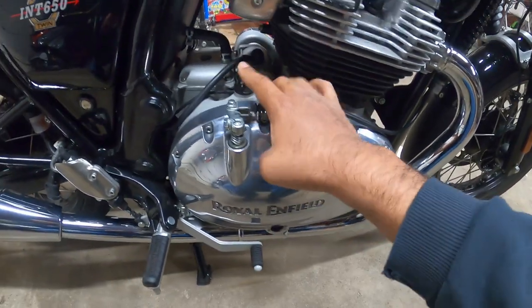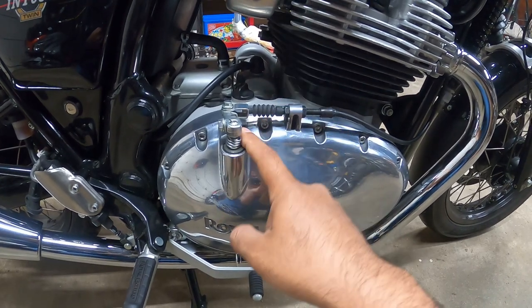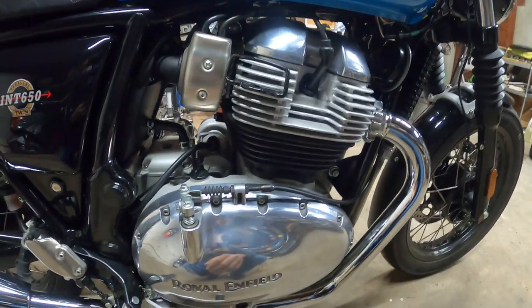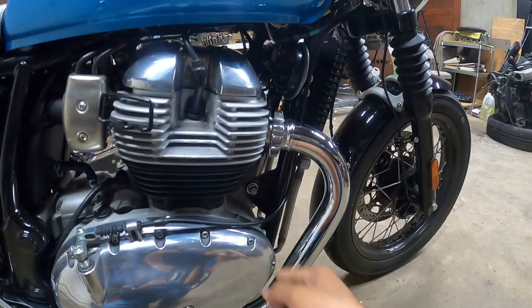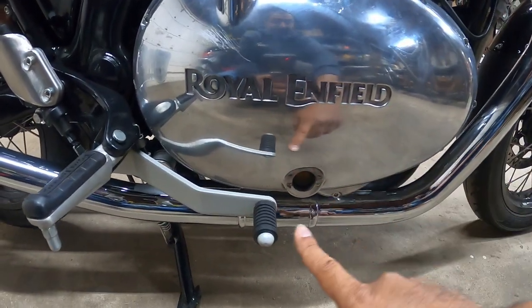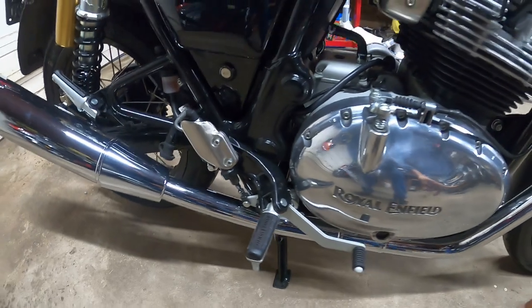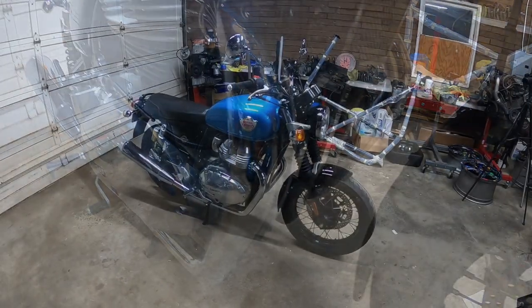The little things that change on this side: you've got your oil fill right here. You have your clutch lever mechanism — this is what actually disengages and engages the clutch itself, with the adjustment over here. The other horn. And obviously we're back to the oil cooler. Down on the actual bottom of the case cover, there's your visual oil fill, which gives you a visual representation of how much oil is in the bike. Working over from there, we have our oil filter.